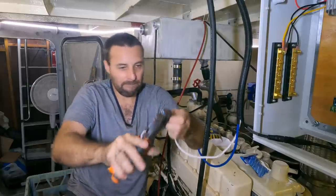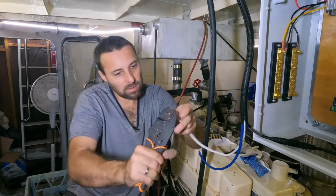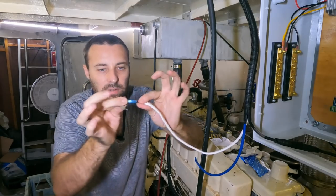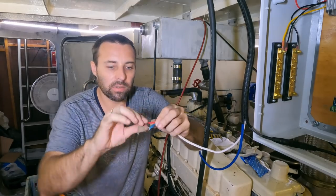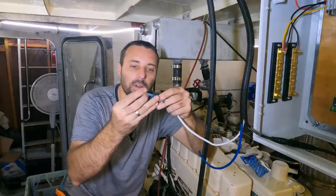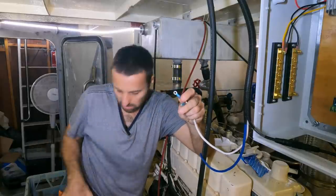Use the right crimp and give it a good squeeze. The litmus test is to make sure it doesn't come loose — you want it nice and tight. That not only means a connection that lasts a long time, but also a decent electrical connection.